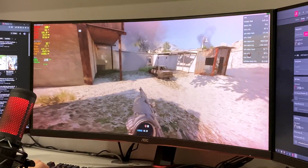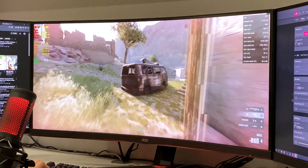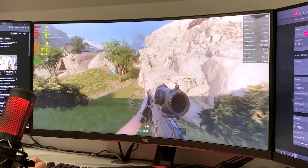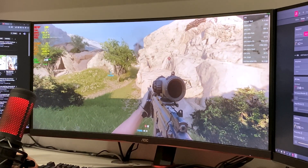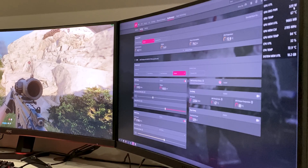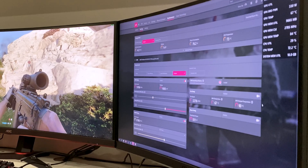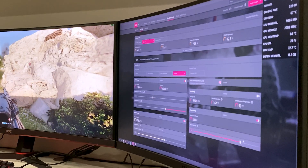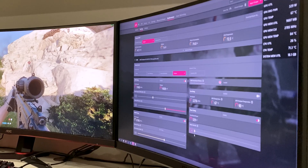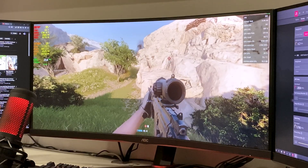So this is minus 80 millivolts — no crashes yet. Right now the power consumption is 340 watts. I'll do a quick alt-tab. Memory temperature is at 84 degrees. Now let's go to power tuning and set it to minus 30 — basically all the way down. Applying changes now. The power should be reduced. Yeah, now it's at 240 watts.